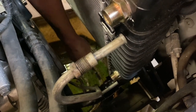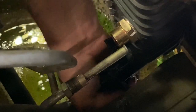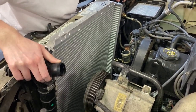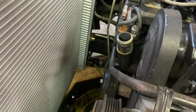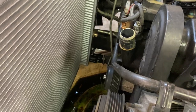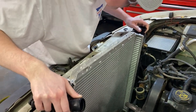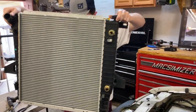I disconnect the lower radiator hose using channel locks on the spring clamp, pulling the hose off and letting the fluid hit the spill pan. Now we're ready to pull the radiator out. Nathaniel is going to take the radiator out — careful, let that extra fluid drain out as you lift it. There's our radiator out. Next, Nathaniel is taking the AC compressor off — he's got the top two bolts out and is pulling the bottom two. There's a connector and a line attached on the back as well.